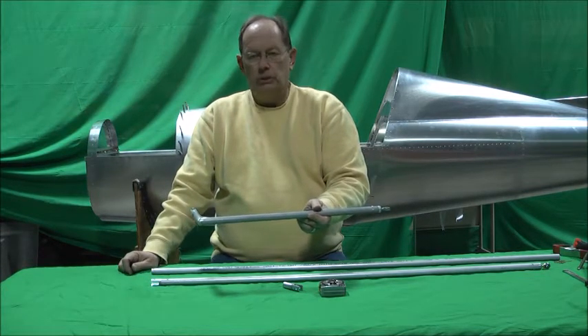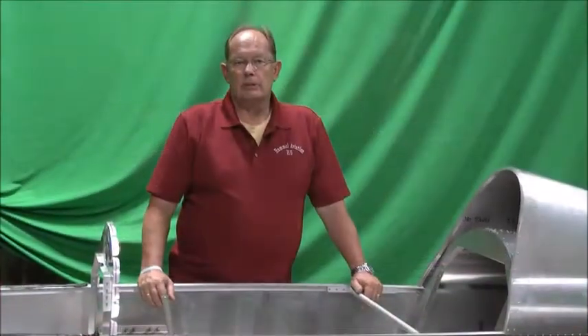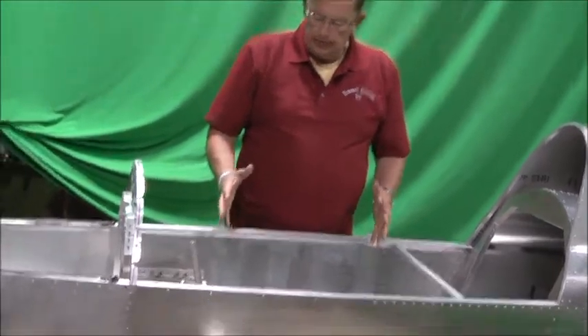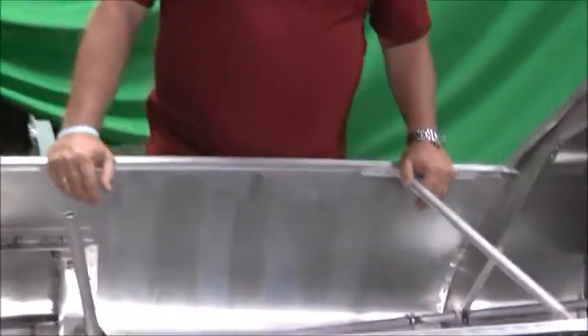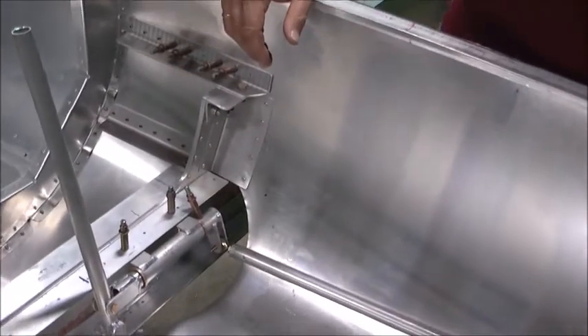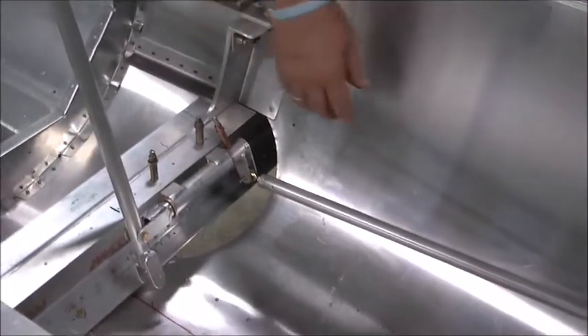We'll get this installed and show you a picture of it being installed. In this session we want to talk about the elevator controls and the control stick assembly. We've got everything Cleco'd into this aircraft for demonstration purposes. The components are simply the two push tubes — the cockpit push tube, which is the short one, connects to the straight aft push tube that goes all the way back to the elevator horn. Same setup basically as the rudder — we've got forks and ball links making these up. It doesn't matter if you put the fork on one side and the ball link on the other, just so they're meeting up.